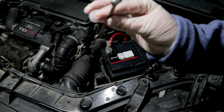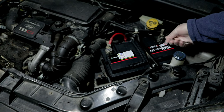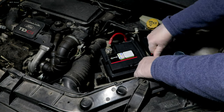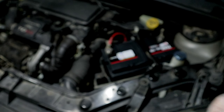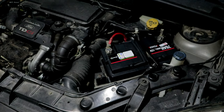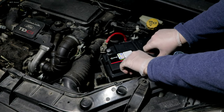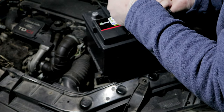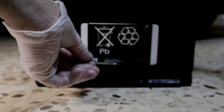For example, waiting for a battery model exactly identical to the standard one to be on offer when it needs replacing is not always probable. Therefore, adapting one on offer, perhaps with a greater capacity, could be a good compromise. But before proceeding, you must make sure it has the positive terminal on the same side as the original, that the dimensions are compatible with the compartment, and that the amperage is not excessively greater than the original — otherwise the cables could be too short, it could be too tall to close the hood, or an excessive amperage could tire the alternator or burn the electrical system or electronic components.